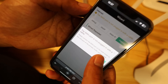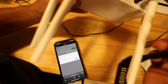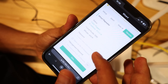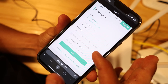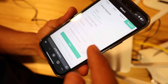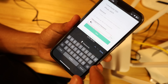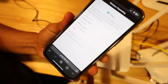I need to plug in the cable so it doesn't give me an error. It says WAN port — I'll plug it in now. Then I'll click OK and it will check the connection. Now I can see a plugged connection. It says 'wired repeater', and as I mentioned, you also have the option of wireless repeating. I can set up the Wi-Fi password here — you can leave it blank or add a password. I'll save this. It's now asking me to set up the administration password. I'll set one: 1, 2, 3, 4, 5, and save. This is already set up.